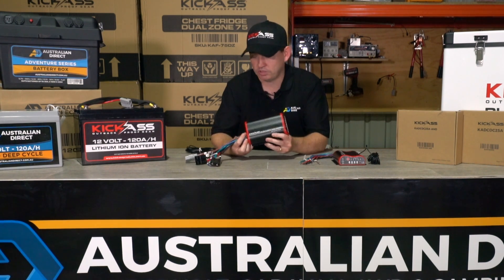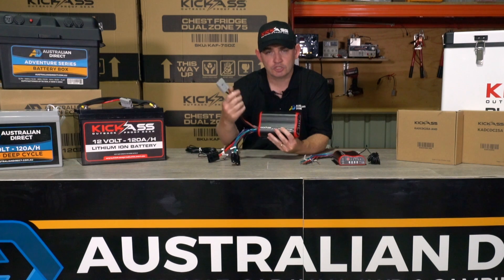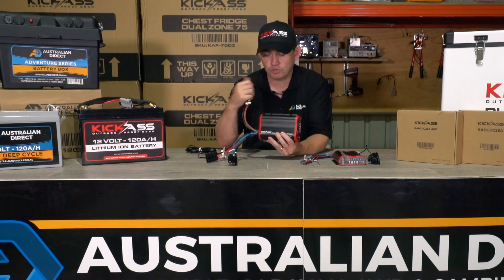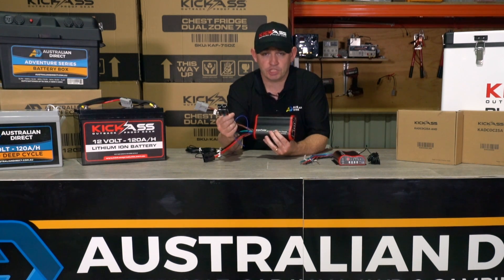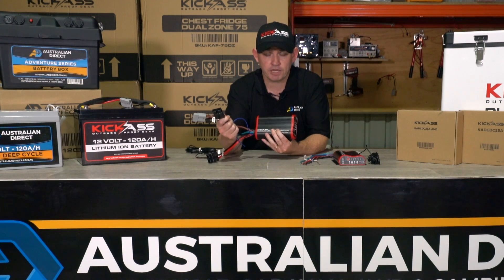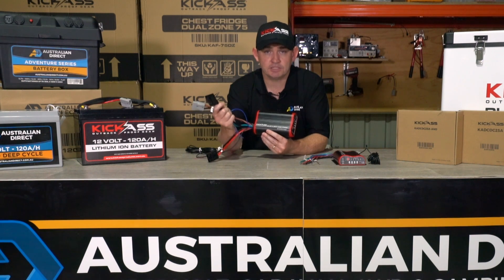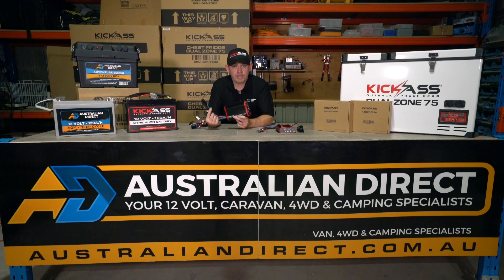As you can see here, we have a solar connection and an alternator connection — this connection goes to your vehicle charging source and this connection is where you plug your solar panels in, which is great for making the most out of your charging sources. You can also use this charger on its own with solar panels — mount it in your caravan and it will act as a complete separate MPPT charger for solar. Just make sure any existing regulator is bypassed so your solar panels feed directly into the input of this charger.